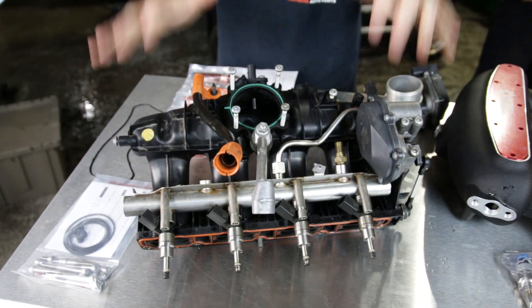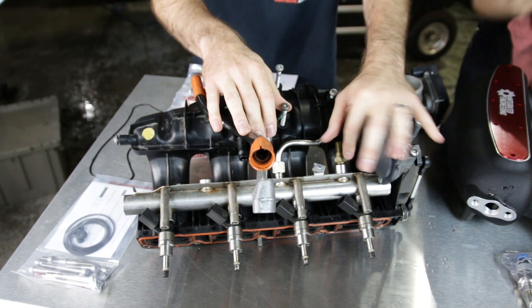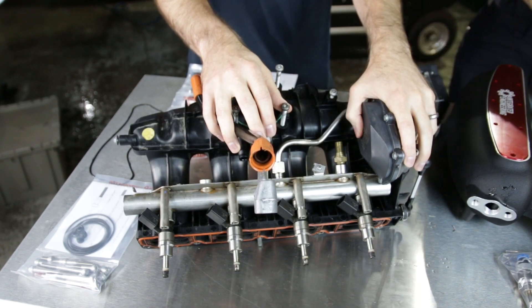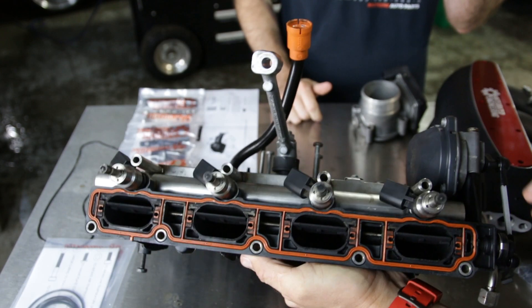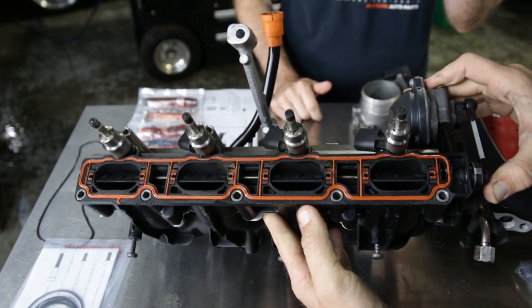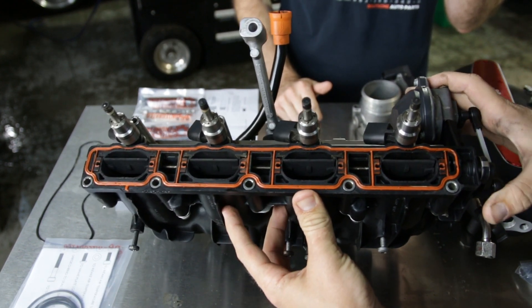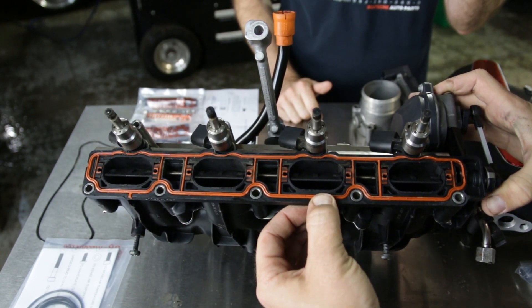So now we're going to proceed with swapping all of this stuff in this general vicinity, which would be the rail, the dipstick tube, obviously the bracket, and all of our fuel lines and everything over from the factory manifold to our Integrated one. We're obviously not going to be taking this motor with us because we're deleting the intake flap runners. To explain a little bit more about the intake runner flaps — a lot of people probably haven't actually seen these things in action — so this is your flap motor connected with a little linkage rod through here, and it's basically like little tiny throttle bodies that block off more than half of the intake port, which causes the air to tumble and build more turbulence. You mostly use it during the cold start phase to help the engine run a little bit better and help emissions during startup.